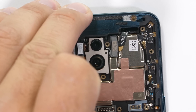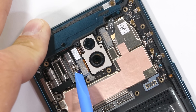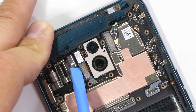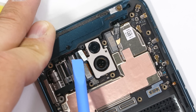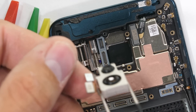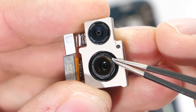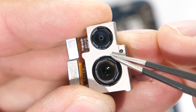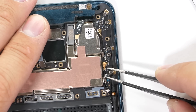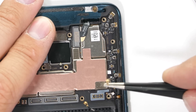We've run into all kinds of pop-up cameras this year: the standard little rectangle that pops up, then there's the flip-up camera, and we've seen whole phones shift up. Now we have this weird triangular version. I'll have to remove the regular rear cameras first. It's a 48 megapixel standard camera with a 5 megapixel depth sensing companion, neither of which have optical image stabilization. I'll remove the two long wire cables from the right side of the board and then unplug the triangular pizza-looking front camera.